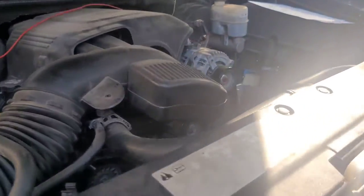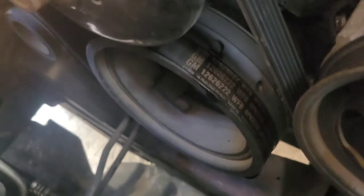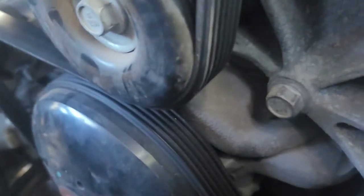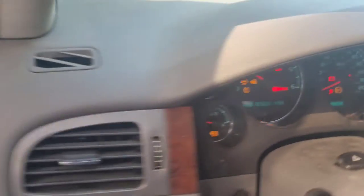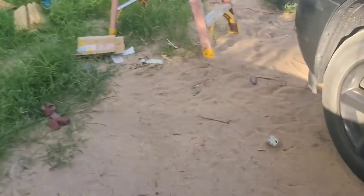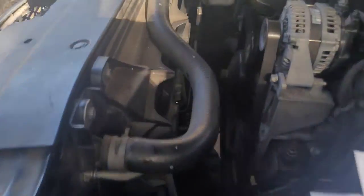You're ready to start up. Double check your pulleys to make sure that they all line up in a straight line — you can look at it like that or just inspect it. This one down here is easy to come off, so just make sure everything's lined up before you crank it. Then come over here and double check that it's all turning good.